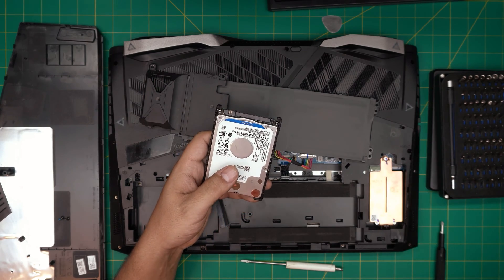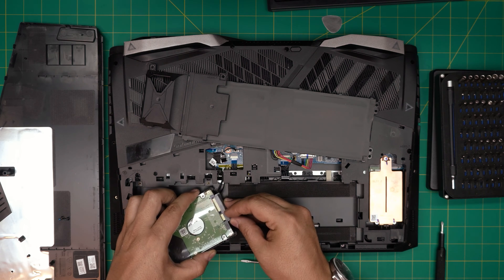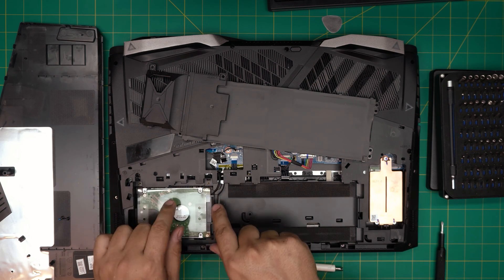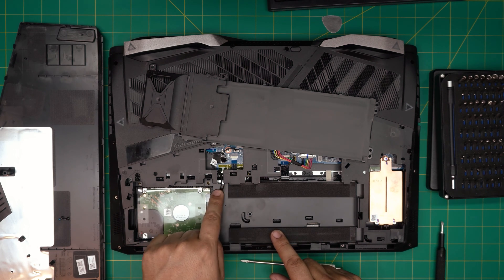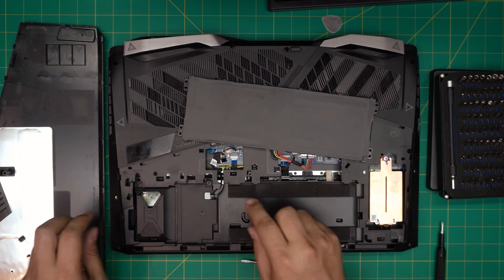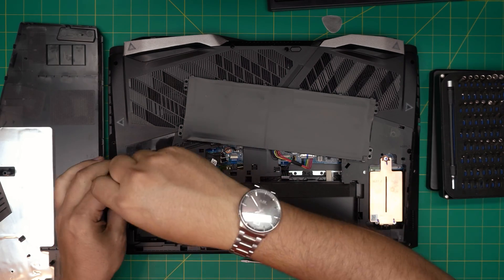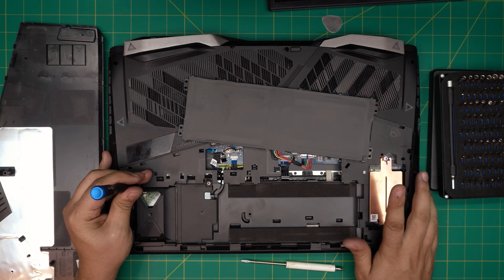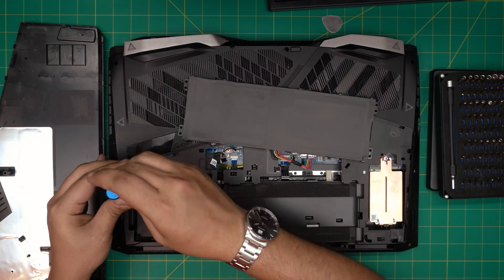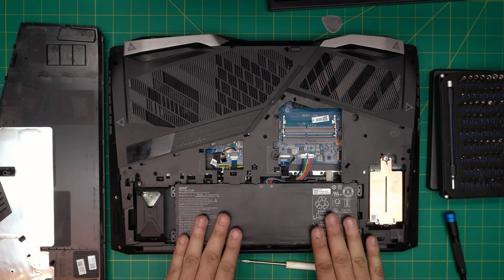The adapter only goes in one way — plug it in, push it through, slide the front end down and push it toward the case, then tuck the cable under the cover. A great combination is a two terabyte mechanical drive here for extra storage, plus two terabyte NVMe drives in both M.2 slots. Or for a bigger budget, go four terabyte plus four terabyte NVMe. Next, reinstall the battery: put the top side under the hinges and slide it down — no screws needed.